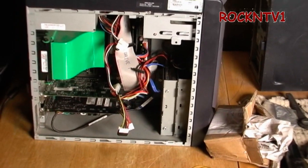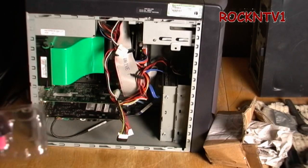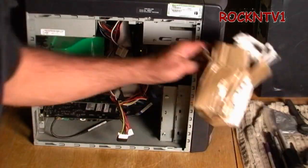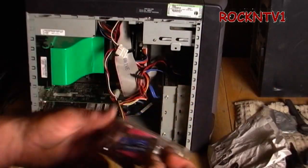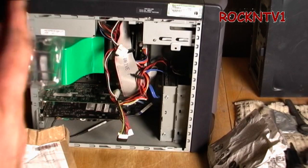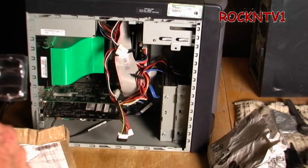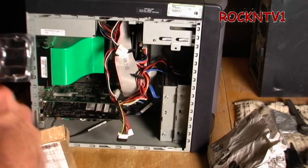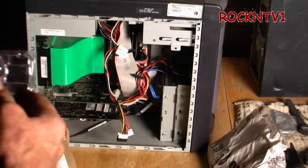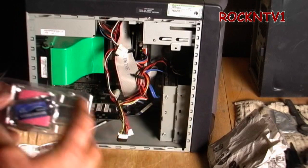What we're about to do is put in a 915G Intel chipset with this Pentium 4 Prescott 3.6GHz that I just got from China in this mangled box — $6.22. If you want to upgrade boxes like this, do yourself a favor: use Windows Device Manager to find out your chipset, then go to Intel or whoever made your chipset and verify what's compatible with that, then verify what's compatible with the rest of the parts on your board and start from there.